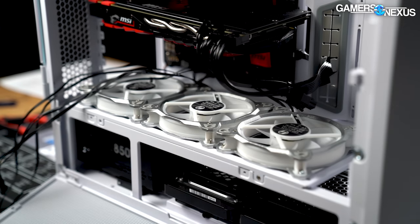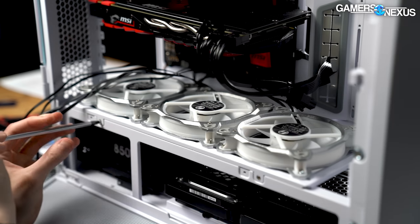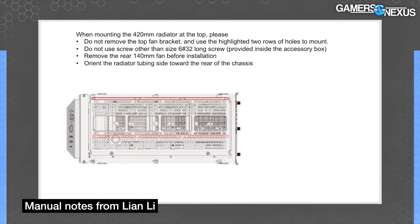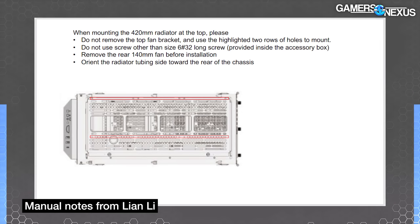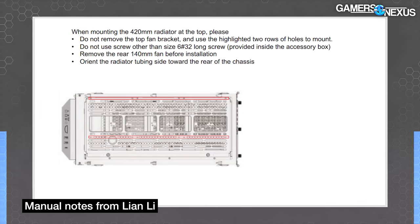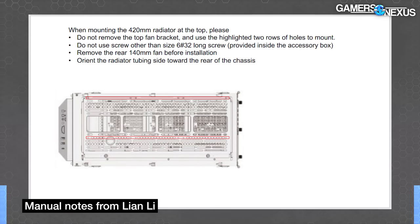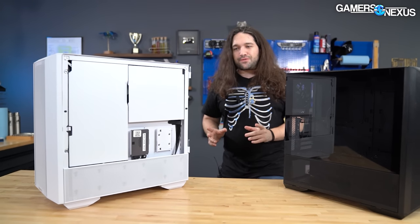The top radiator mount isn't tool-less but is still removable, and the quantity of mounting points make it extremely versatile, though that also means there's only a 5cm strip of fully open space in the center. The case can mount 360mm radiators at the front and on top of the power supply shroud. Mounting fans or radiators on the shroud eliminates the use of the bottom-most motherboard expansion slots and requires moving the shroud top forward, though there's still enough ventilation on the lower side panels to make it viable. Lian Li claims the top mount fits 420mm radiators, but installing one may make the top tray non-removable.